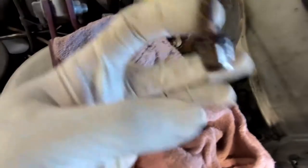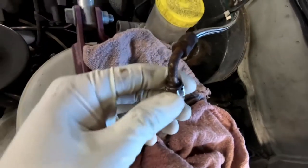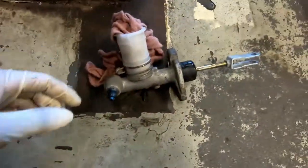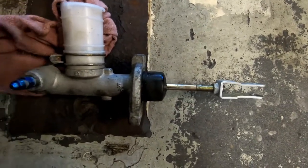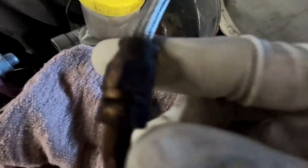We were able to break it loose — it's moving a little bit. I'm cleaning it, making sure the swivel fitting moves freely so I can tighten it. I've gotta take this AN fitting and put it on the new one. I don't want to spend money on a pre-made line so I made my own — I learned the way to do it. This line is a little rusted; I've been using it for a good minute so I might want to replace it soon.